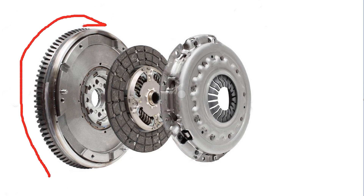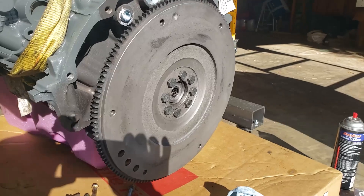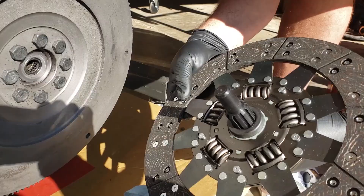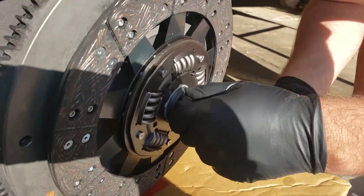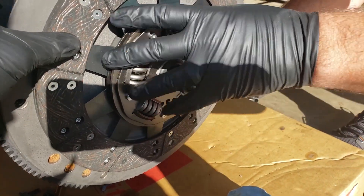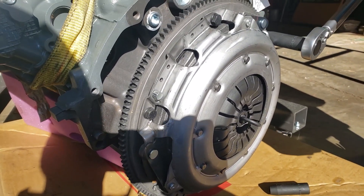When you release the clutch, pressure gets applied to the clutch plate — attached to the flywheel. I'm not turning the flywheel for demonstration, it's too dang heavy. What do the springs do? They dampen the torque when you're engaging it, so it doesn't just jam in. Otherwise without them it would just grab hold and jerk your truck around.